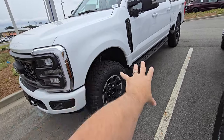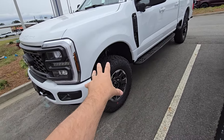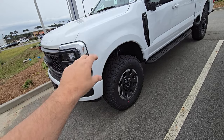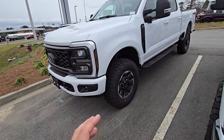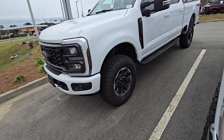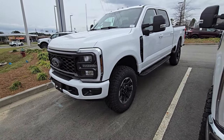But all of that weight is right here, and it doesn't matter whether you get the back wheels locked up or not. If you can't get some kind of power coming from the front, and I don't mean just four-wheel drive, which is going to give you one wheel spinning, basically. If you can't get a limited slip or a locker set up or something in the front, this thing is going to just sink like a stone, and it's not going to work real well. By Ford giving you that Dana 60 series front axle and having that limited slip setup and the option of being able to aftermarket add a true locker into it is an absolute gold mine to be able to get this thing to perform off-road the way you want it to.